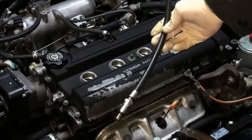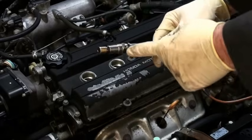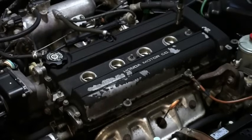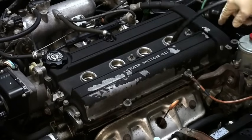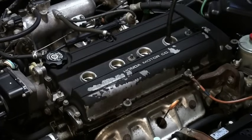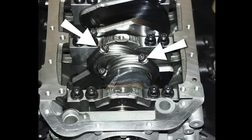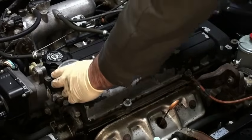Next, take the hose from your compression tester. There are two different sized spark plug holes — this one is the smaller size, and this tester has an adapter for both the larger and the smaller. I start with number one spark plug, which is the one closest to the front of the engine. On a V-shaped engine, one half sits a little closer to the front because the pistons are offset. Now I'm going to hook up the compression gauge.